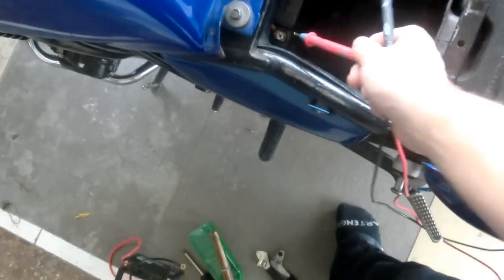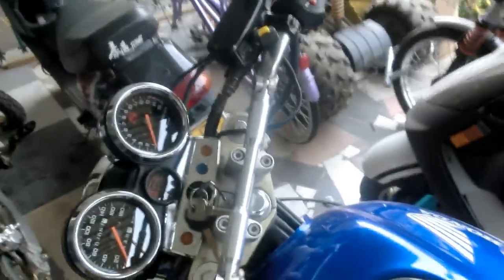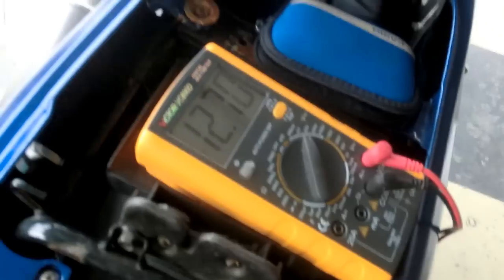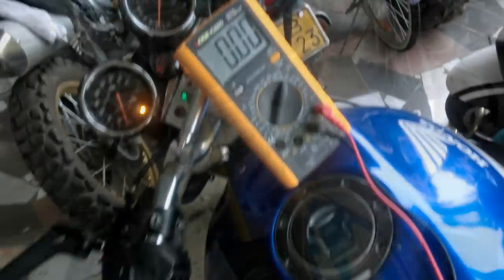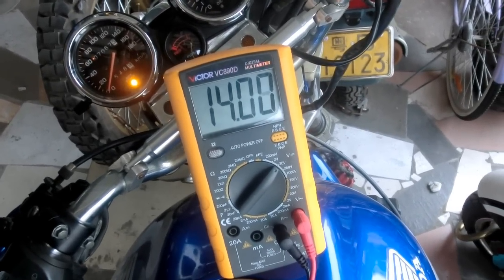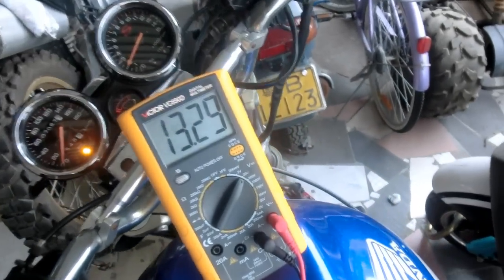I decided I'll just take a look at what's going on here with my battery. If I connect it up directly, I'm getting 13-point-whatever. I'm going to turn on the ignition. Now I'm getting 12.8 as usual because the lights are on now, so it's draining a bit of the battery. Now let me show you the cool part. As you can see, it's idling — let me give it a bit of a rev. Look at that. That is beautiful. You know what that means? That means the bike's charging without any problems. That's brilliant.